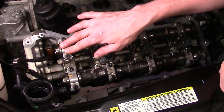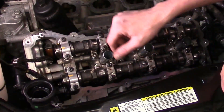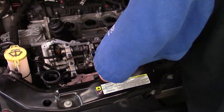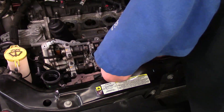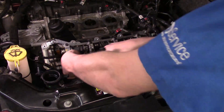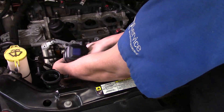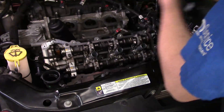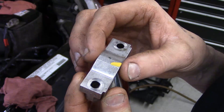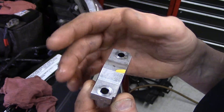The new head is going to come with its own bearing caps — they've been machined for that head. But I'll show you the actual markings on them. This is one of the bearing caps; this is one of the front ones because they're a lot wider than the rest. The rest going back are smaller — the two up front are the largest.